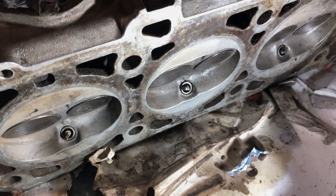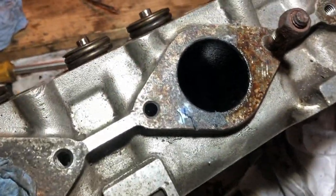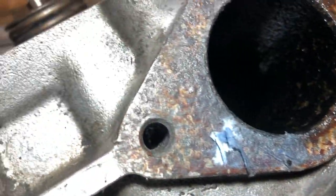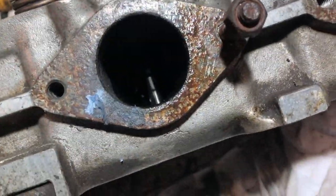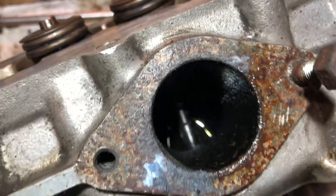I'm trying the petrol test to see if the valves are sealing. I was pouring it down the exhaust and it was all disappearing - I couldn't work out where it was going. Then I noticed a pool of petrol at this end - it's coming out of that fitting there. I guess that's where the air piece comes in for the smog pump. There's a little hole at the back - I'm going to block it and try again.